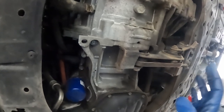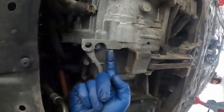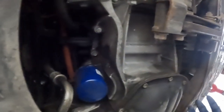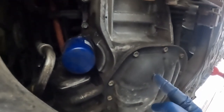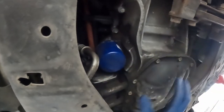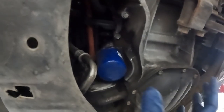Looking under here it looks doable, but I'm not sure. We have this torque strut that needs to come off because it's connected to the pan here. We have this pan bolt that goes into the tranny — there's another one here that goes into the tranny, two on the other side just the same. Need to pull the filter off of course, we'll be draining the oil. There's a hidden bolt underneath the oil filter. The rest are just bolts holding it into the block. The AC compressor has to come off. On this side there are a couple of bolts for the timing chain cover that also need to come off, and that's my biggest concern — with all the bolts off, is it too squished in between the transmission and the timing cover to pop out?